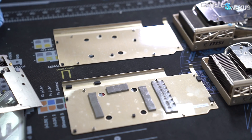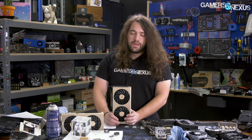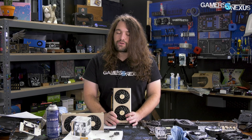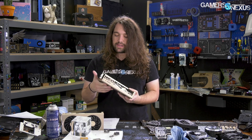If you bought one of the originals and want yours fixed, MSI is offering an RMA program where you can get the pads replaced — they should not really charge you anything, and hopefully not even for shipping. They're not sending the pads out for you to replace yourself, but in our assembling and disassembling of this card, the biggest issue has been getting junction temperature back to where it started before disassembly. There's a mounting pressure issue if it's reassembled in any way except one specific configuration, so we think it's okay that they're requiring the MSI team to do the reassembly and disassembly for this one.